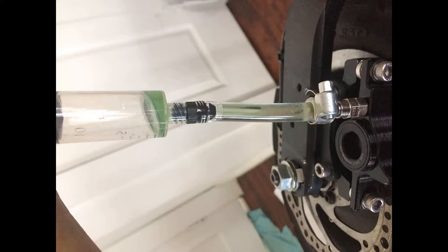You also have to make sure that the bleed valve — the upper part — is opened enough. It has to be well opened. If it's not fully opened, it will stop you from doing the bleeding; you will not be able to pump the liquid into the system and the bubbles will not come out either, because there's not enough opening. Make sure you allow full opening — turn the upper part of the bleeder counterclockwise at least one full turn, if not more, until it works.